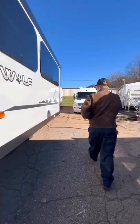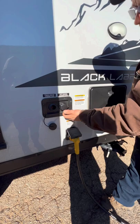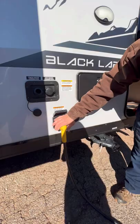Here is going to be your fresh water connection. If you're going to carry water with you, this is where you fill it up with the water hose. If you're going to be where they provide water, this is where you hook your water hose up. I recommend using a water pressure regulator that's not going to let you exceed 50 PSI incoming pressure, to keep from damaging your internal plumbing. Right here is going to be a 30-amp service connection for your electric.